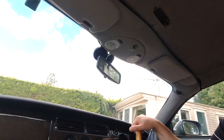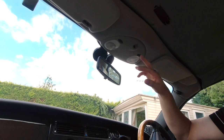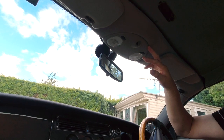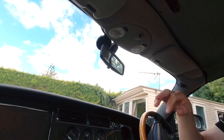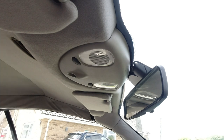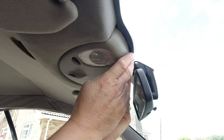It's again another little secret of the XK8 — you can't actually remove the lenses at all to get at the bulbs. What you need to do is remove the entire trim piece and then get at the bulbs from above. But there are literally no screws or fixings in this unit, so how do you get to them?